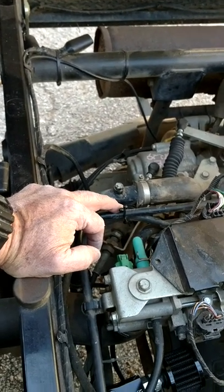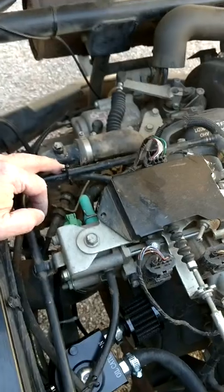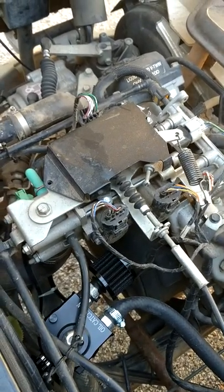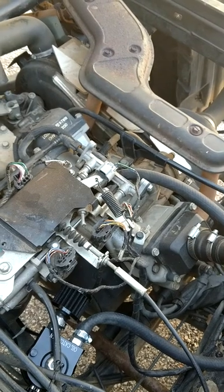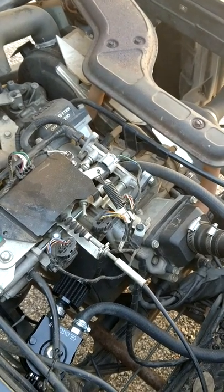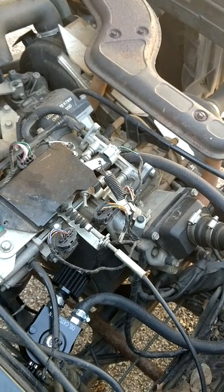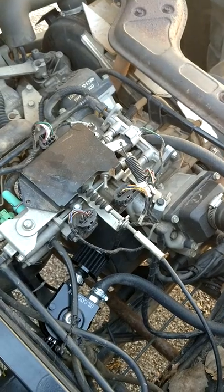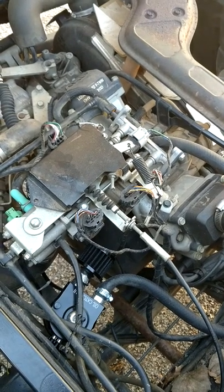After that, I don't know what they're going to do, but I hope this solves the problem. I think it's a step in the right direction. I'll report back occasionally and let you all know how it's going. I think I'm on to the root cause of the problem — it's not just that the throttle body gets dirty on its own. It's because you're pumping oily fumes in there and it's gumming everything up. So we'll see. If anybody has any questions, just leave me a note and I'll try to get back to you.